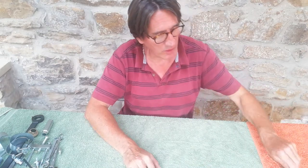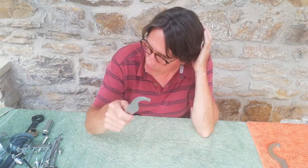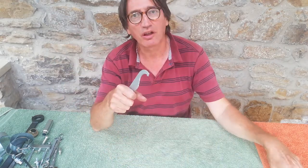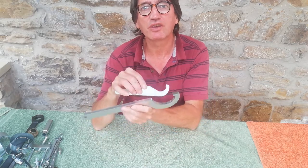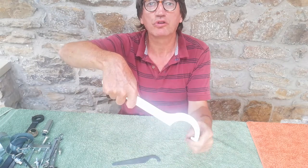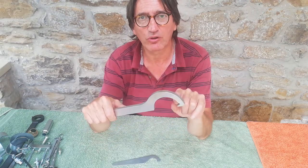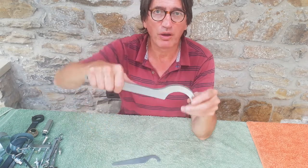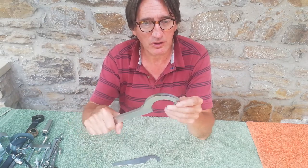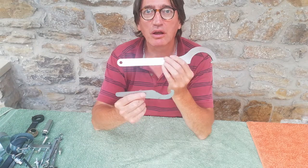When tightening up the exhaust roses — where the exhaust pipe goes into the cylinder — I was using a Hagon shock absorber adjuster, clipping it on the rose and tightening up, but it wasn't tight enough. Then I discovered this much bigger version — basically the same but about ten times bigger. This goes on the rose; get it down to the bottom of the fins so you don't break a fin. Get the engine really, really red hot, tighten them, and do that a few times — that's the secret to keeping them tight. Don't try using the little one like I was doing.